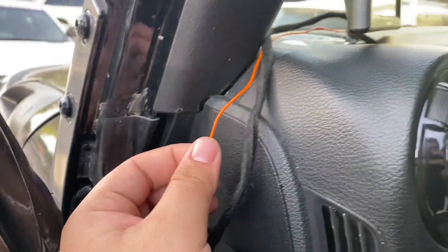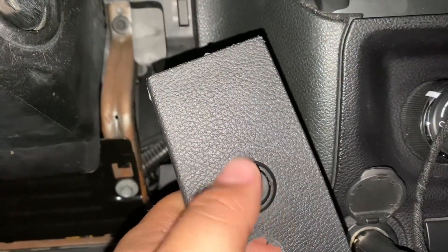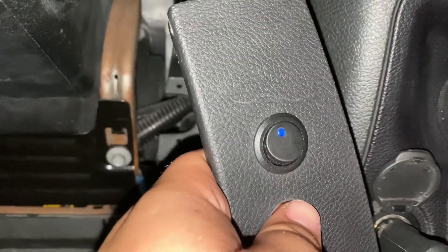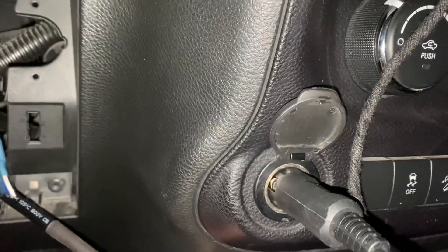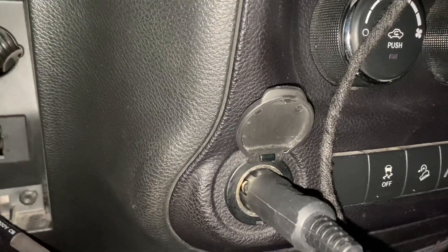The ground connects to the chassis, and then the power I'm going to run all the way through to the battery — there's a hole in the firewall right over there. It's all preference. I'm going to be wiring it straight to the battery so whenever I'm at a Jeep meet, bonfires, get-togethers, I'll be able to have the lights on without having the car on accessory mode and worry about my battery draining. I'm going to have it wired to the battery, fused. If you do it to the cigarette lighter, when you turn off your car the lights go off. I'm going to be running a switch so I'll be able to turn it on and off whenever I want. If you guys want to have it on a key start, I'd recommend the cigarette lighter — it's a lot easier.